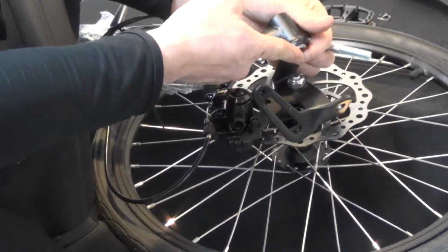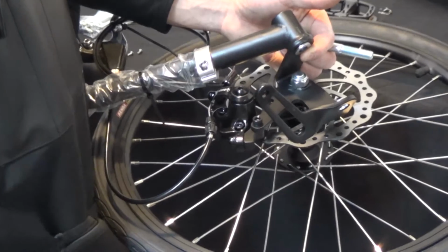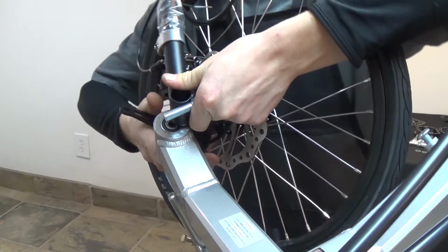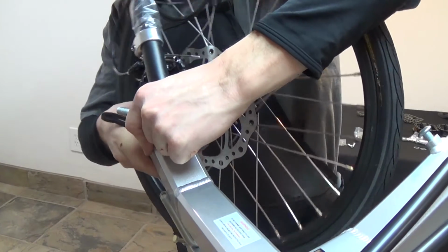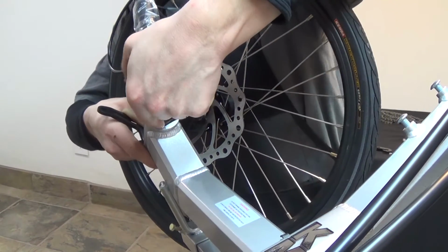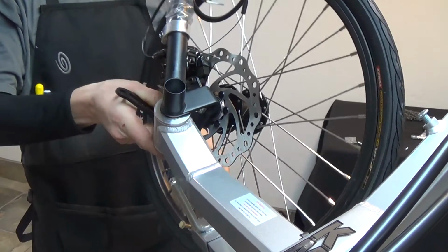Grab one of your steering assemblies and install 2 of the bushings. There will be 1 bushing for the top and 1 for the bottom on each steering knuckle. The bushings don't have an extremely tight fit, so you may need to hold it in place. First, slip the knuckle over the steer tube and insert the M10 bolt and washer. Next, take your M10 nut and washer and install them on the bottom side of the M10 bolt.